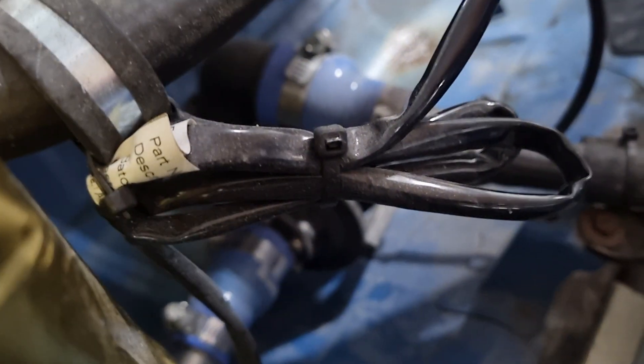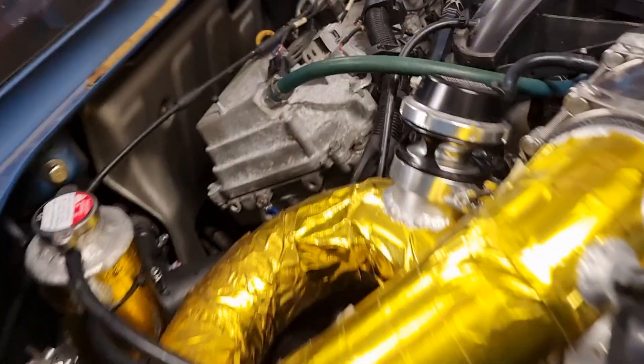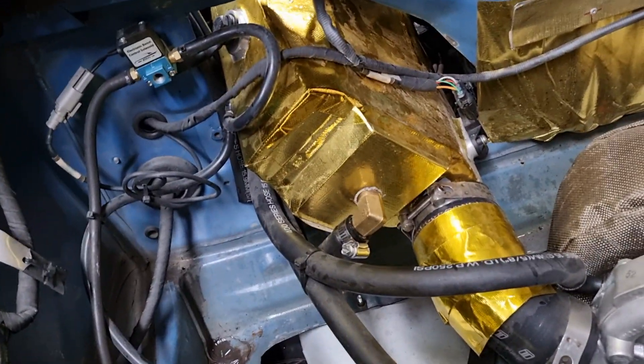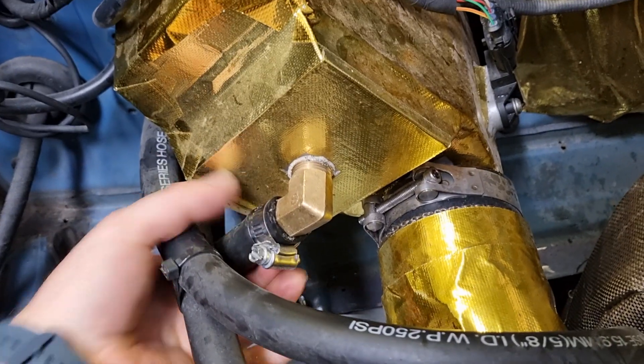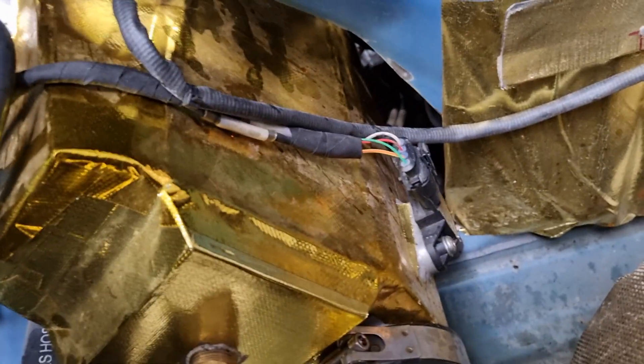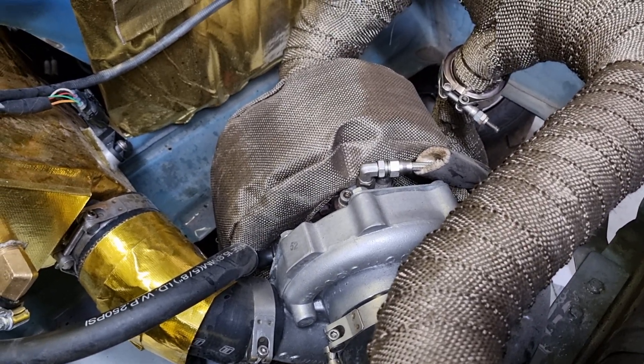From the reservoir, down to the pump, through the pump to the back of the car. The change I made is that it now goes through a joiner and into the heat exchanger — the intercooler which is plumbed in the back here. This fitting's not ideal, a smoother transition would be nicer, but so be it. The pump is running and I can't really hear any air bubbles, so it's moving quite nicely. This is the big boy — Garrett GT4088R.